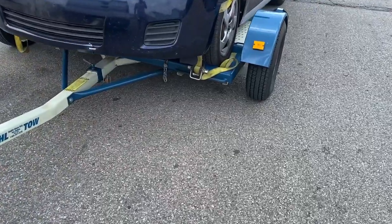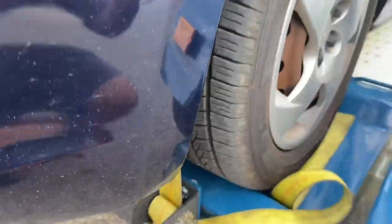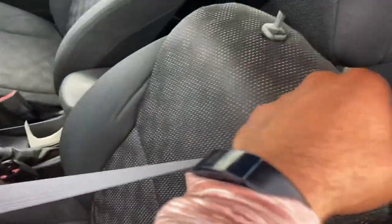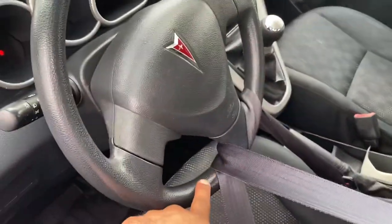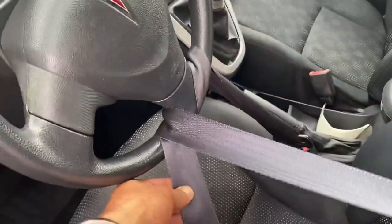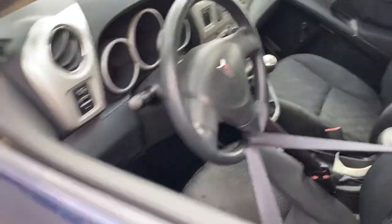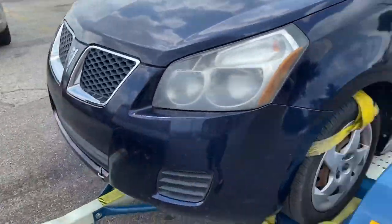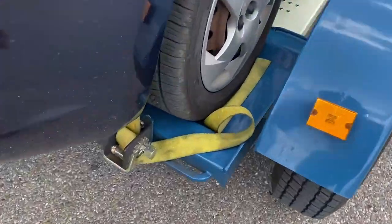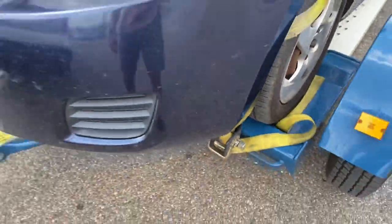Now that you're all strapped up, make sure the straps are as tight as possible on both ends. Then come inside the car, pull the seatbelt all the way until there's no slack, wrap it around the steering wheel, and hook it in. Pull your seat back so there's tension and the steering wheel doesn't go left or right. You don't have to do that, but it's just an extra safety precaution. Then make a lap around the parking lot once or twice — the straps will come a little undone, so simply tighten them up again and you're good for the rest of the trip.